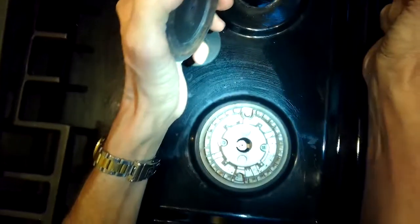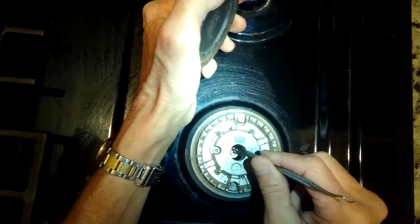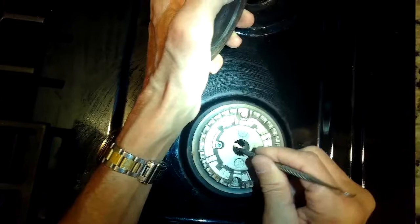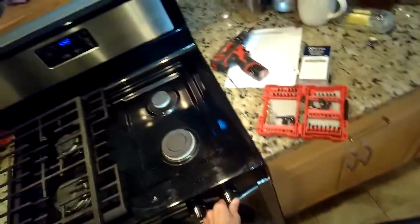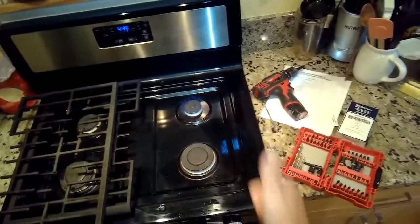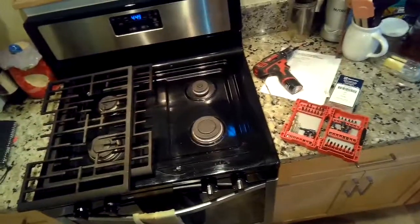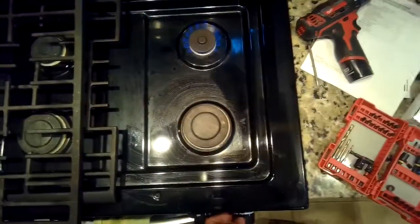Here's a look at the front burner where you can see the little brass piece with a hole in the middle. I'm using a dental tool and just wiggling it around to clean out any junk in there. Then put the burner cap back on and test it. Now we have a proper flame — about three times bigger than it was. A really easy fix!